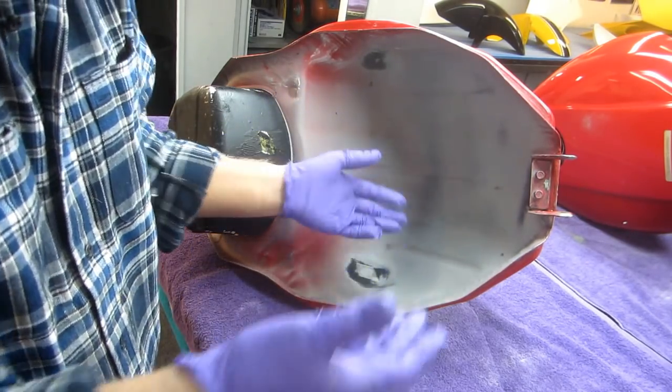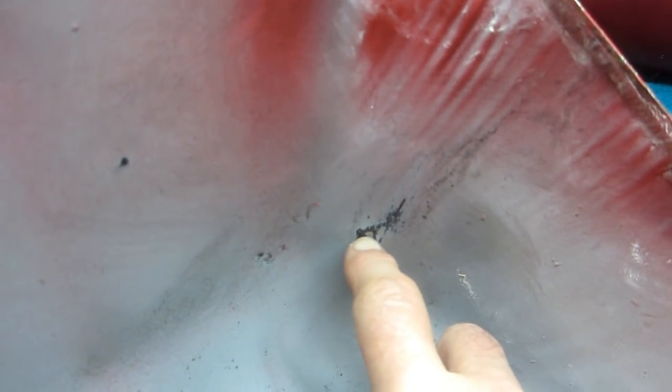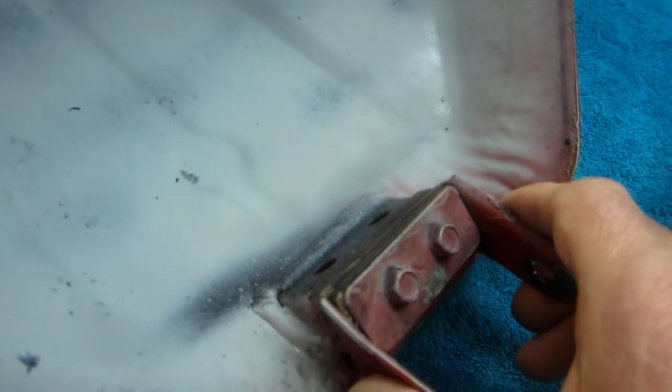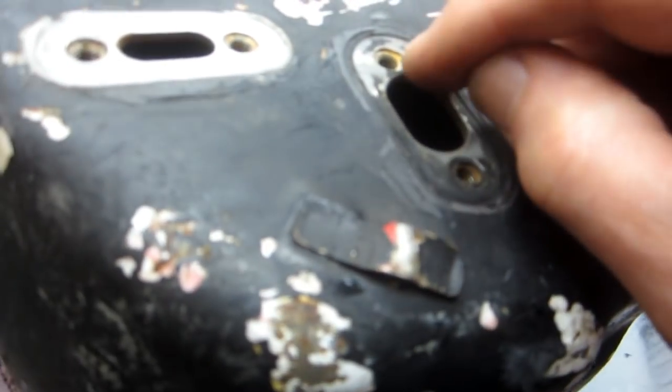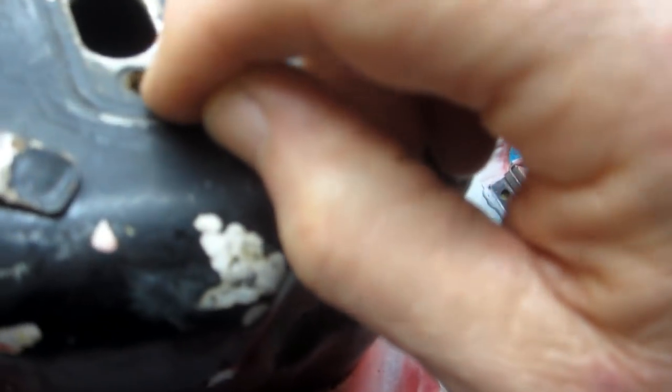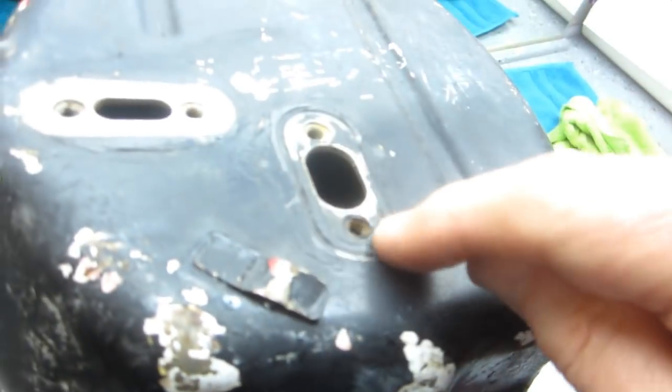It's rubbing on the plastic air box, but I'm going to put a little patch of fiberglass there — just let it wear out the air box, it won't really matter. Because the tank is rubber mounted it floats a little bit. And up here — this is the reason I didn't want to break this seal, but I do have some new parts. The most important thing is to get the new washers that go around here. I'll have to clean this all up very carefully — I don't want anything to drop into the tank. Then I'll put Gorilla tape over this to seal that up.